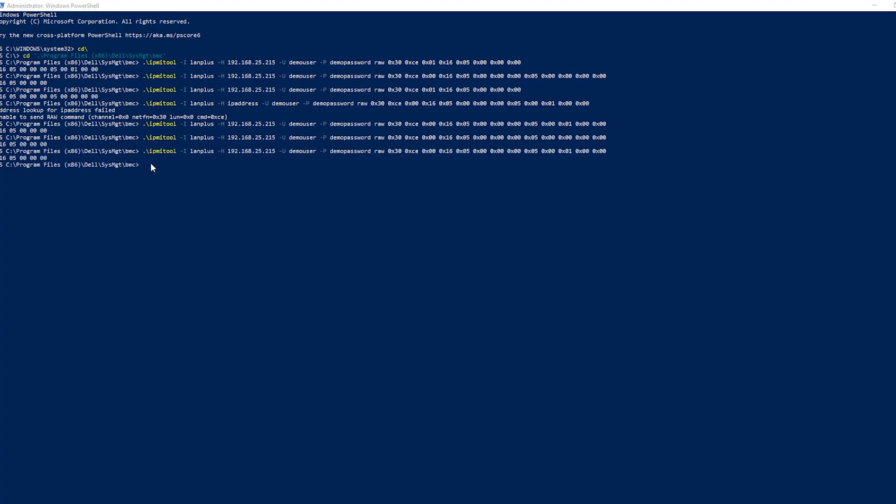We can check to verify the output now that the fans have ramped down. And you can see we're back to disabled with 00 here. Hopefully this has helped you quiet down your noisy Dell server. I love my Dell servers, but I love a quiet office even more. Again, you can use either PowerShell or Command Prompt for this — just make sure you note the difference in commands, with PowerShell having the dot-backslash. You don't need to use that in Command Prompt.